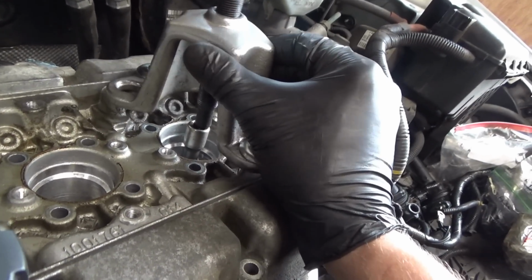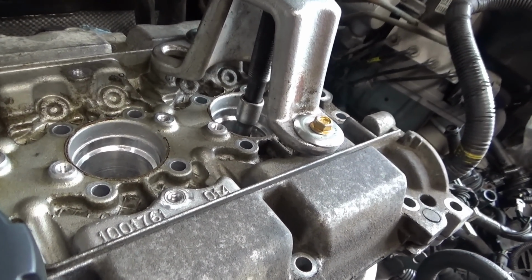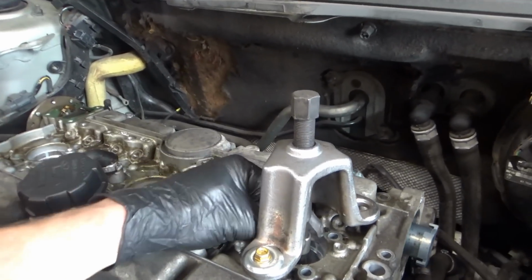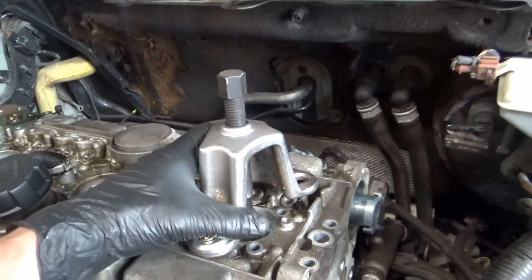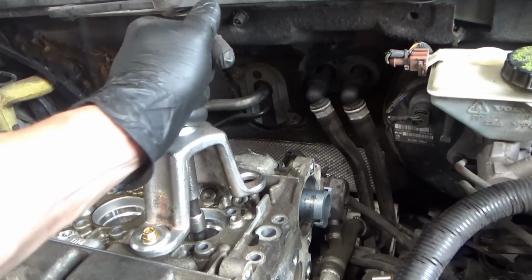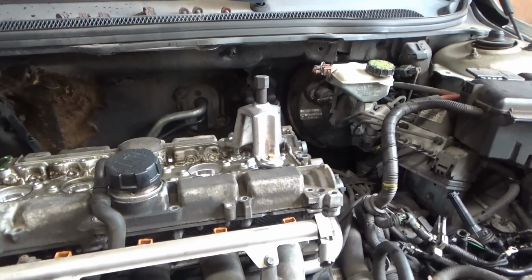And this thing is still floating. And then I have a spark plug socket, an extension, and then the bolt will push on that, and hopefully lift this whole thing up. So I'm going to carefully preload it. We don't want to have anything crooked here. Make sure that's centered. And preload it and then help it out with pliers, and hopefully something will crack loose.